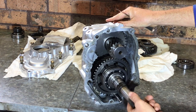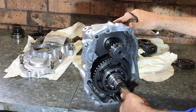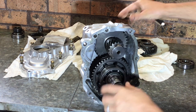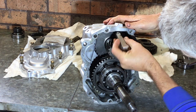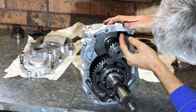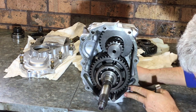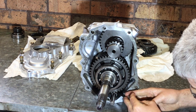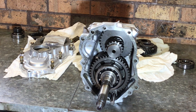We're checking for smooth rotation and operation — it's in neutral there. So if we go forward like that, that's low range. There's high range, one to one straight through. What I'm looking for here is at least half a millimeter clearance all around the idler gear at the bottom of the case, wherever we've had to take a bit of material away, and also on the shift fork — clearance between the gear and the fork. We're all clear so that can stay together. If there's any interference, it all has to come apart, a bit more clearancing, put it back together, try again.